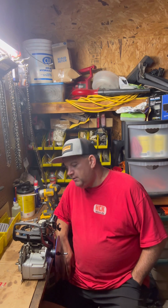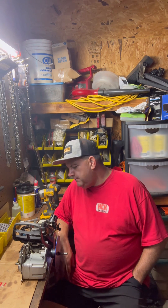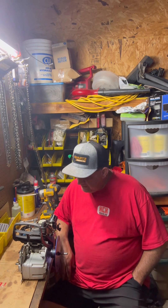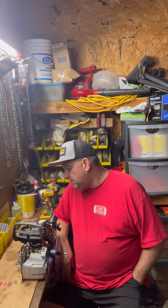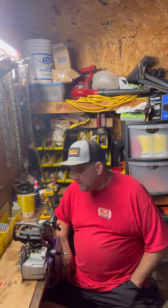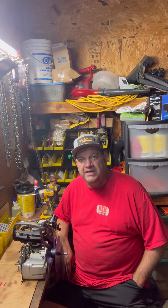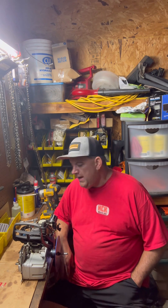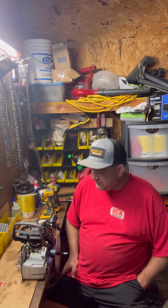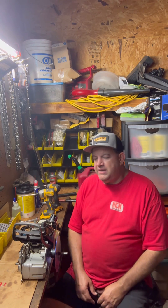So we're definitely going to lower the bottom of this intake. I haven't opened it yet, but having done enough of these I know there's a considerable amount of transfer work you can do in them. The blowdown on this saw is 22 degrees, which is pretty good. We'll work the transfers, but the majority of the work is going to be in the base of the intake — we're going to lower it and widen it, and cut the base of the cylinder. Once the base is cut and the cylinder is ported and we get it back together, I'll bring you back for a test fire. Have a good one.